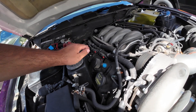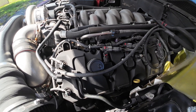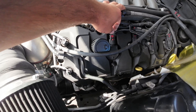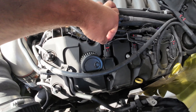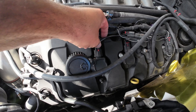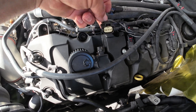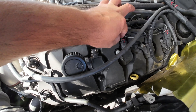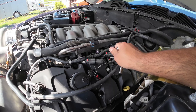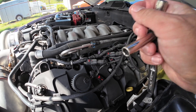Now we're going to take every single coil off and every single plug out. Taking all the plugs out at the same time is a good idea because it limits the amount of compression and lets the engine spin a bit freer. To take the coils off they have these retaining clips — pry these up, push down on that pin, and they pop right off. There's some water in there because of the louvered hood and all the rain we've had.